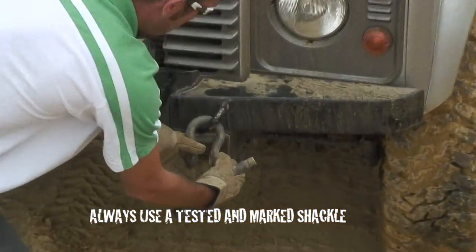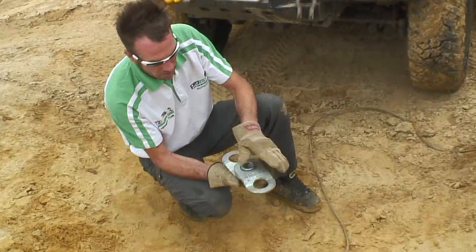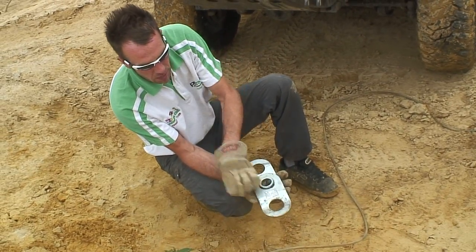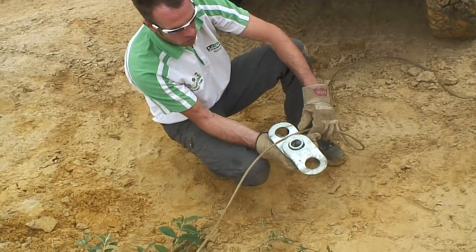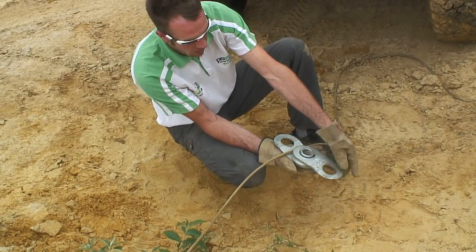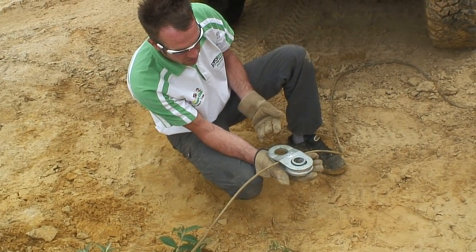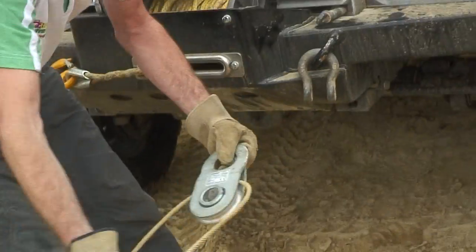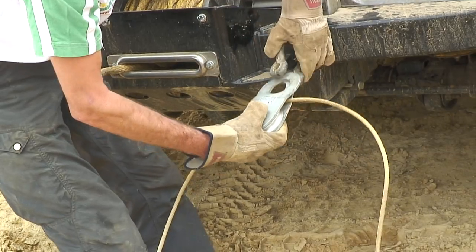Again, it just gives us the ability to put the pulley block in. So here we have the pulley block. We can clearly see this is how it's going to work in action. This is how we fit it on. Very simple, slide it into the groove here, into the small pulley wheel, sliding it round, minding out with the fingers, again always wearing gloves, and then as simple as doubling the line, I'm now going to fasten it to the shackle,